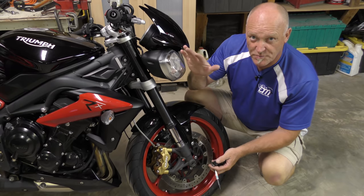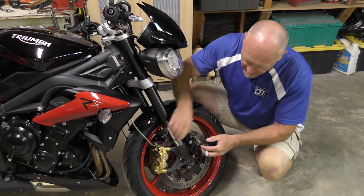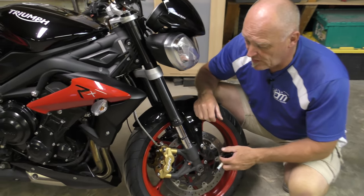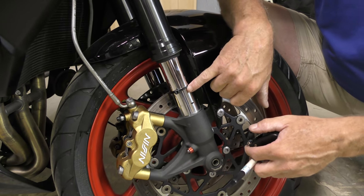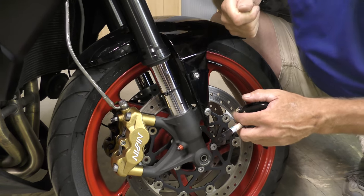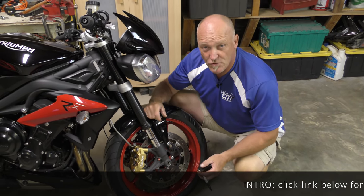Given the damping and springs, these springs are going to be fine for me. I can fine-tune preload, fine-tune compression, and at that point get myself where I need to be with my safety buffer so I can ride with confidence knowing I have something left. If I came back with no compression and no preload, all this unused travel means the fork height is high, so you're working way too hard to turn — braking or decelerating past the apex and keeping weight on the handlebar. That's way too much work.